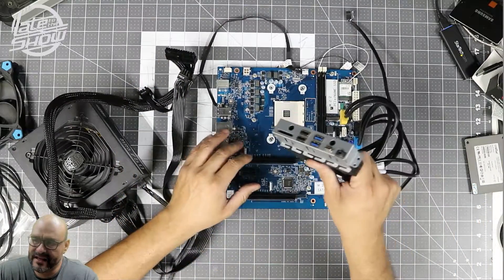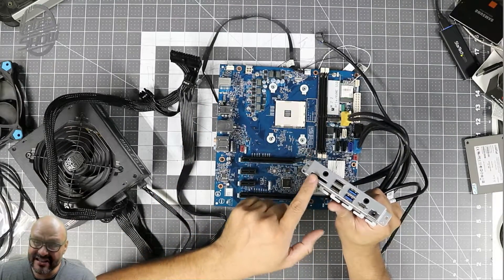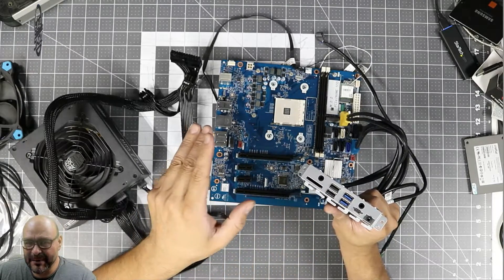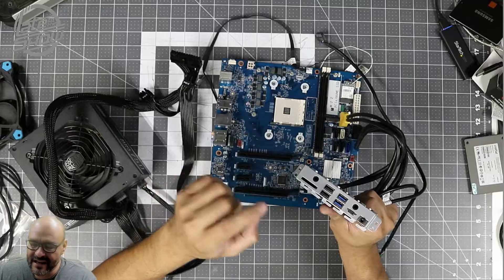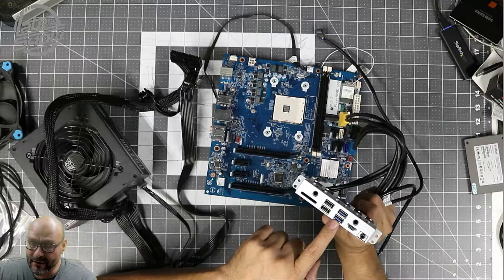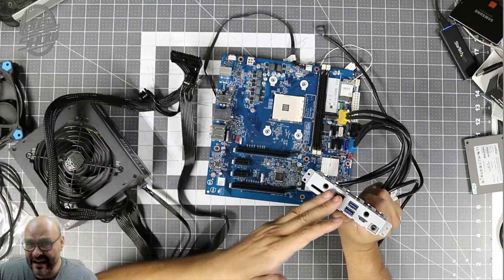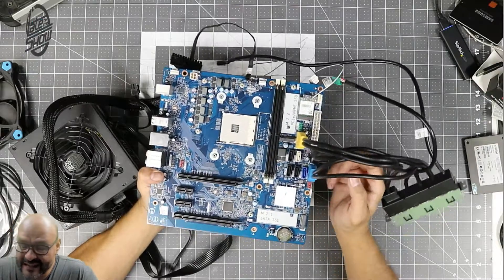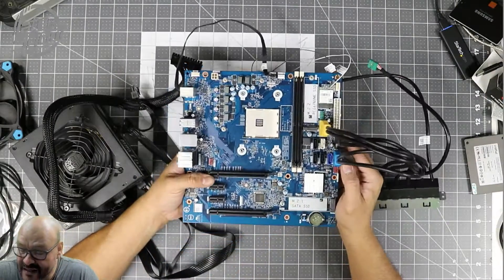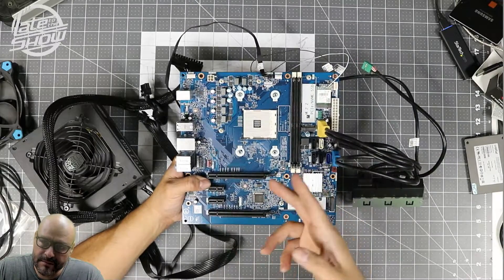You can migrate this to a new tower, but there are other complications. The big complication is this — all these connections that connect back to the motherboard. You're going to have to find slots, and some towers don't have front slots or have unique slots for certain inputs. A lot of people start cutting through face plates and melting on the plastic versions. You're going to have to migrate the part that retains your Type-C, USB 3.0, SD card reader, and audio. On the motherboard itself they give you Type-C, USB 3.0, SSD connections, and SATA connections, but modifying those is a little difficult — you have to go into the motherboard BIOS to change them.